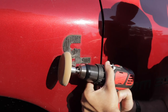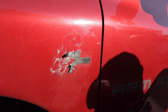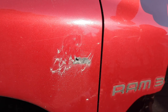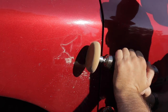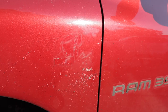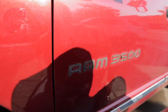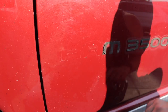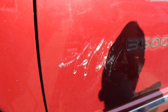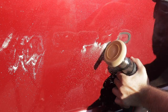Now it's time to break out the power tools. The eraser wheel peels off that adhesive nice and easy, and because of the rubbery compound it's really easy on the paint itself. This honestly took about two to three minutes tops to get this emblem off. Here's a little tip: if the eraser wheel is spinning downwards, put it at the top of the adhesive; if it's spinning upwards, put it at the bottom. It kind of helps pull up or peel up the adhesive as opposed to trying to eat through it.